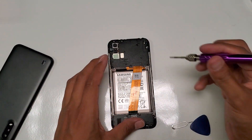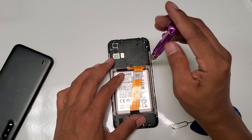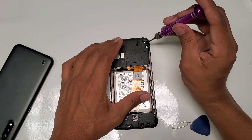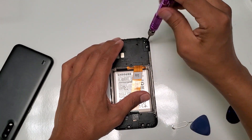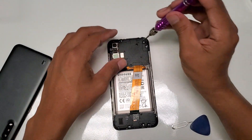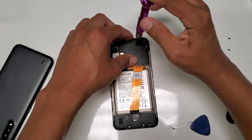From here you should have eight screws. Now using the Phillips head screwdriver, we remove all eight. Just put them to the side where you don't lose them. These should all be the same size, so there's no issue if you mix them up.